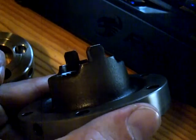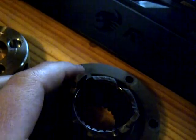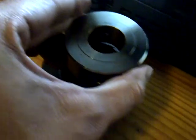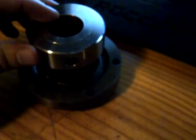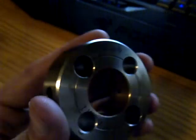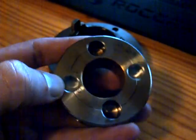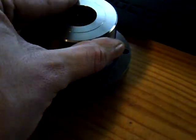The tabs inserted into the pump disk have tolerances that are too great, leaving a severe amount of play. That ends up sounding like a noise when the car is idling. The solution is measuring and drilling new holes, which gives you a solid fit.